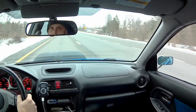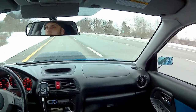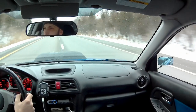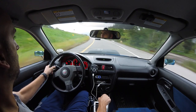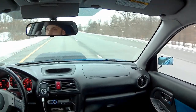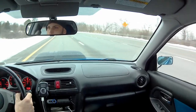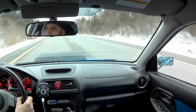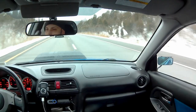I highly recommend this to anyone. I've been driving the car like this for a couple weeks now, so I can give you an honest opinion — not just a first-drive 'oh it feels great' type thing. The kit adds half a degree of camber up front. The funny thing is you don't notice how much the front end of the car lifts up when you get on it and brakes heavily until you put this mod in and realize how much it doesn't move now. Before, you just didn't realize it — that's just normal. And as your suspension gets weaker, that lifting sensation when you get on it and nose-dive under braking will accentuate with worn-out springs and suspension.